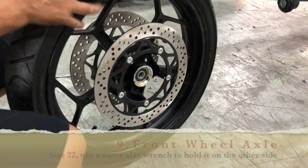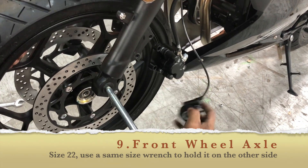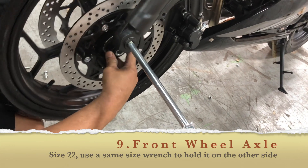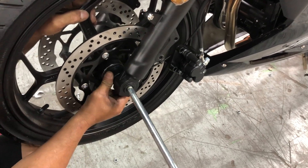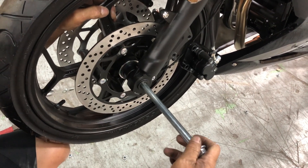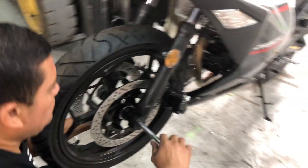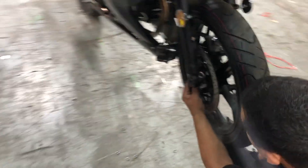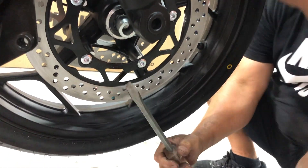That's the front wheel. Almost done — that's the front axle bolt. Lifts it up like this. And that's the speed sensor that goes in there — don't forget to put that in. Line it up with the hole and just slide it in there, turn it in by itself. And don't forget about the spacer — that little thing right there that goes in.